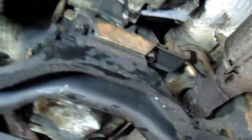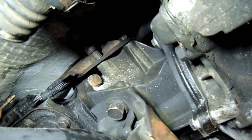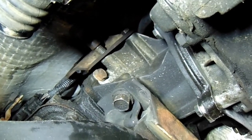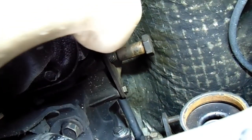She bolted in there no problem. I switched over to standard 9/16 bolts and it slid right in. Now I'm working on the shifter. The shifter is disassembled and it mounts to these two bosses on the transmission — it's a stock transmission. It's got two bolt holes on the side that were empty: the small one is 3/8 and the big one is 9/16, both coarse thread. That bracket just fits right in here, no problem.